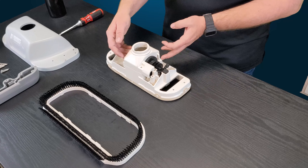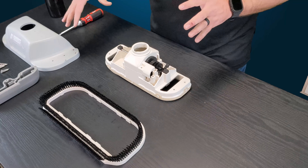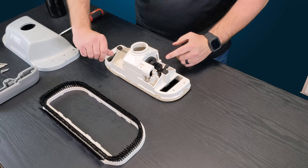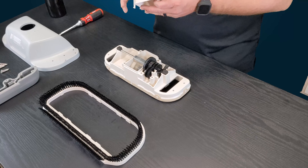And here's your top chamber cap that you're looking at. Located caddy corner, just like the screws were for our main frame — to take it off, these are just pushed in, it's just a pressure fit. It's got a little clip on them, so you're going to kind of push in on both sides here and then gently lift up, and it's going to take off that whole chamber cap for you.